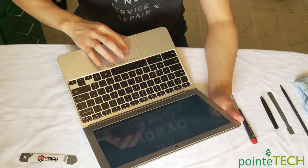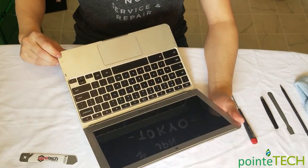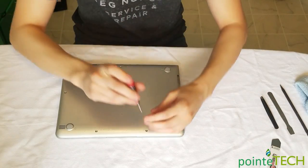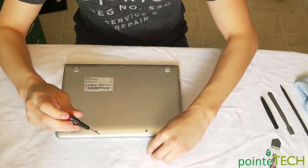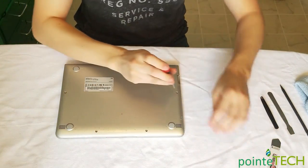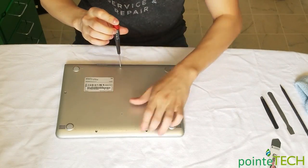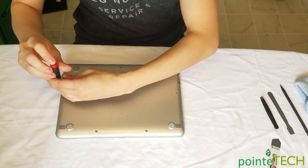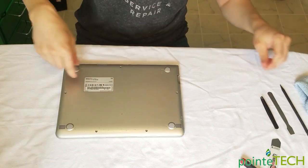Let's go ahead and turn this off first. These Chromebooks turn on when you open them. Let's go into this and show you how to fix that touch pad permanently. Take the screws off the bottom case — you've got screws along the outside: one, two, three, four, five screws that you can see. Take those off.